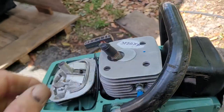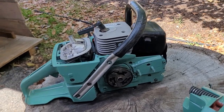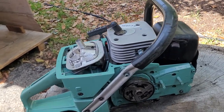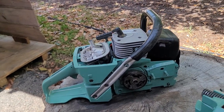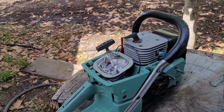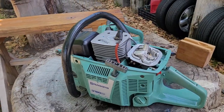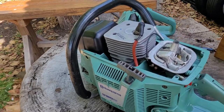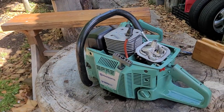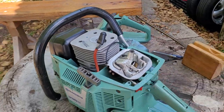That coil's got a super low rev limiter on it, but these rods are known to go bad, so I think you make the power between there and you're fine. I don't know about putting an unlimited coil on it with the stock rod — you can, just got to be careful. This thing's got excellent throttle response so far. We'll have to hit some wood with it and see how it works. I opened the exhaust port up a little bit, did a tiny bit to the intake just to kind of wake it up. Base gasket delete — I think, I'm not sure, I can't remember if I did it or not. That came out pretty good though. Put OEM decals on it. Thanks for watching.